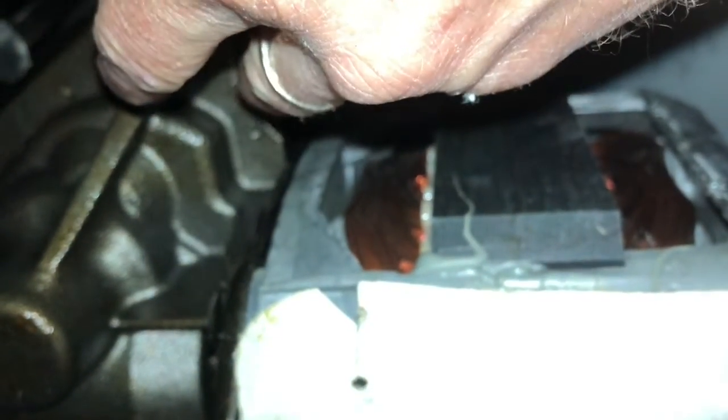The reason the machine could still drain even with a broken coupler is that the motor can still work — when it spins, that powers the drain pump. But the shaft that goes back into the transmission — that connection was broken, so it couldn't move the agitator or the spin basket. It can do the drain, but not the spin.